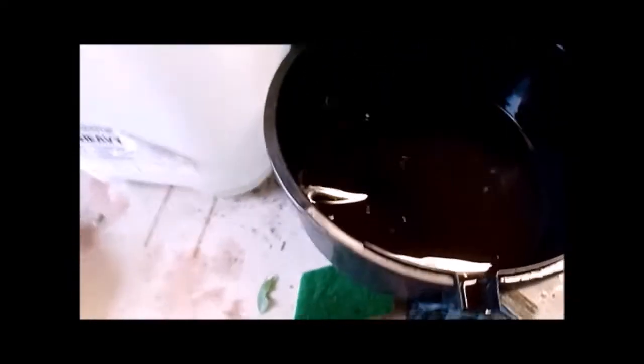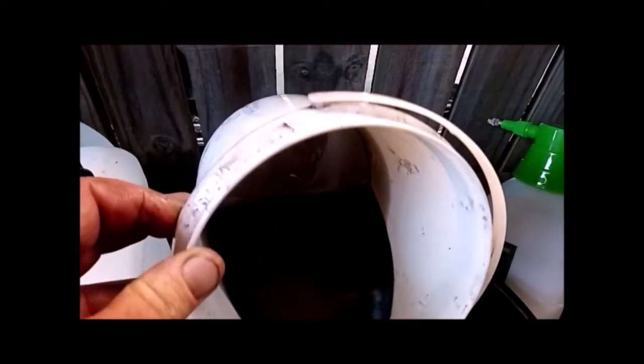One of the fork legs had a seal replaced at some time, I'd say, and they didn't do both forks, they only did one, and that's just like sludge coming out of there. So one was relatively new, that was the red oil. It wasn't too bad, but what used to be the green oil, yeah, it was absolutely putrid.